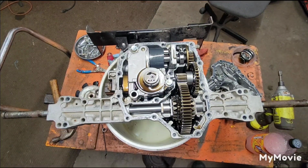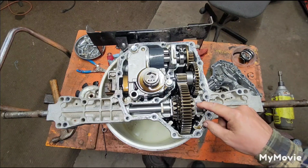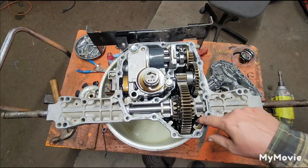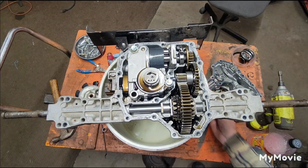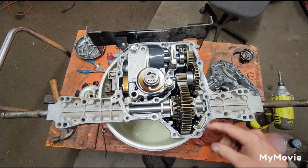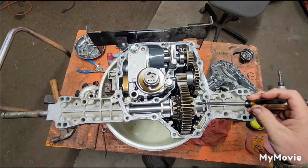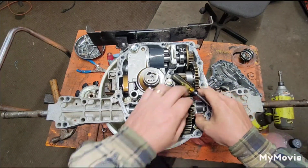So what I want to do is check the gears to see if there's any excessive wear. And remember, there's a magnet that sits right in this slot right here. I already took it out because I've got to clean it. So the magnet is right by the gears. If there was anything severe, I think I'd find a lot of metal on that. And it was just that gray crap. But this magnet isn't really strong. Hopefully it's going to be strong enough